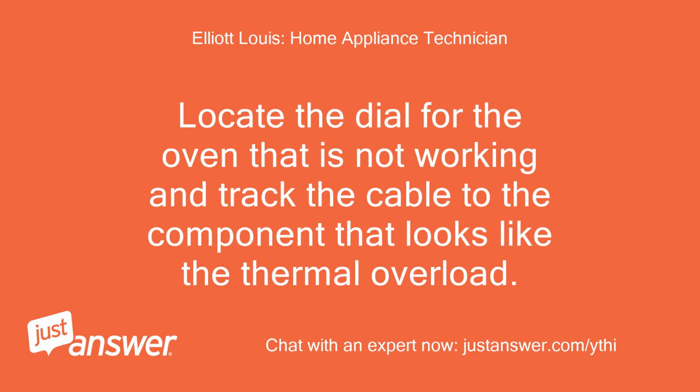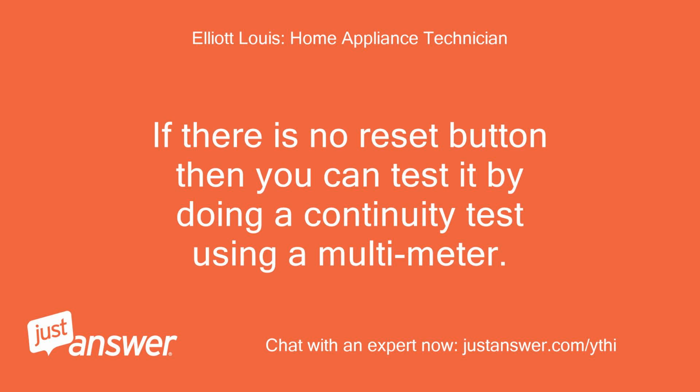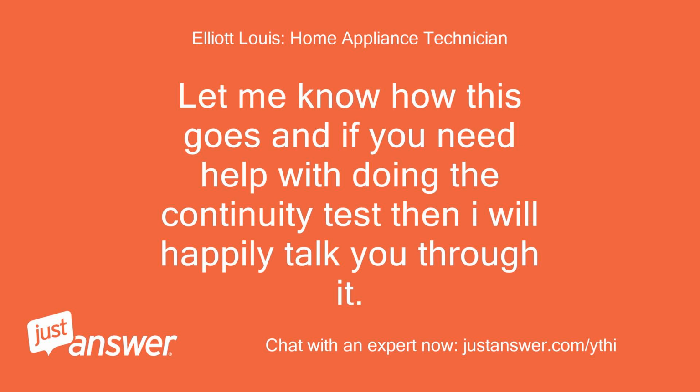Locate the dial for the oven that is not working and track the cable to the component that looks like the thermal overload. Look to see if there is a reset button on it and try to reset it. If there is no reset button, then you can test it by doing a continuity test using a multimeter. Let me know how this goes, and if you need help with doing the continuity test, then I will happily talk you through it.